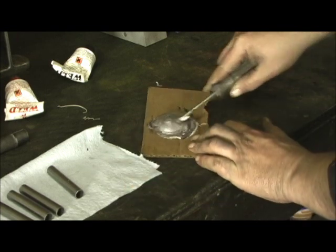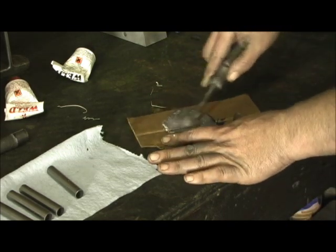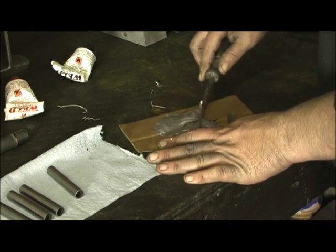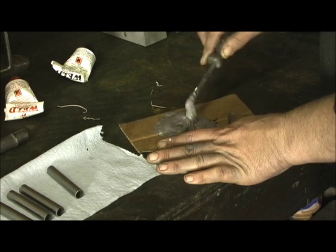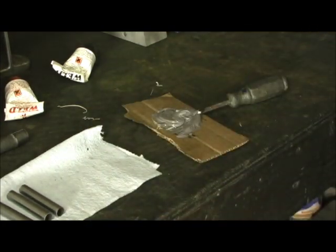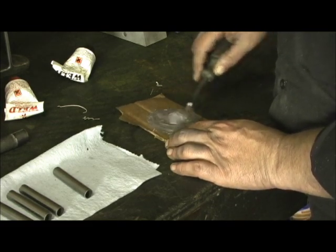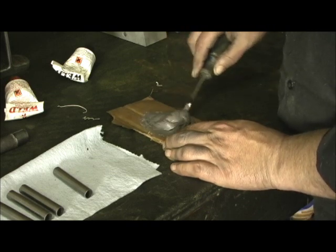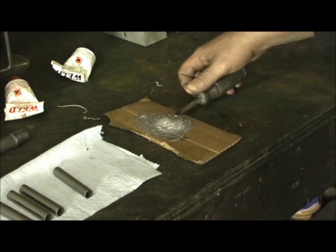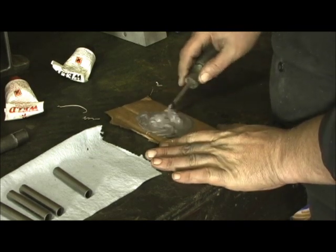Like I mentioned earlier, don't let this scare you. Over the years I've had people scared to death that all the epoxy will come out. But here's the problem with that theory — this is not holding pressure. All this is, is a backup for the tubes because the tubes are press fit into the head. This is just acting like a secondary thing to keep a vacuum leak from going between the cylinders. So there is no danger here. With combining this with a press fit, it'll never come off. You'll wear the piston rings cleanly out of the motor with 300,000 miles before this stuff would ever let go.